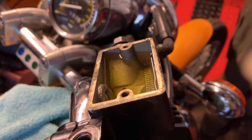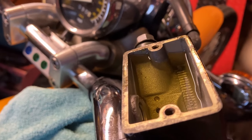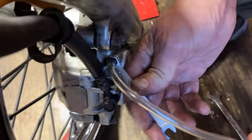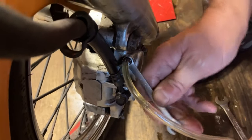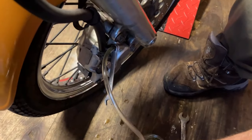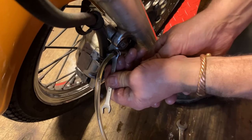I think we do it the old-fashioned way - just pump it up a little bit, then hold the lever down, I'll loosen the nipple off, and then tighten the bolt up. Let's do it the old-fashioned way on camera. I'll put the spanner on the nut, put the pipe on there. Cameraman, pump up the brake. Hold the brake down. Release and pump up again. Hold in. Release. Pump it. Hold it. Release. You can see there's no air in there now.